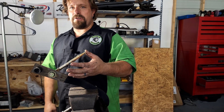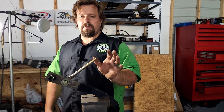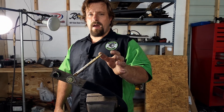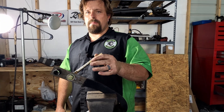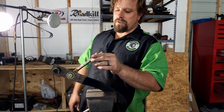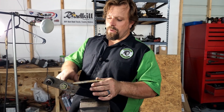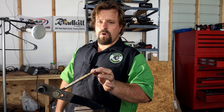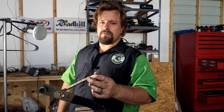We've increased our pedal ratio. That is also going to increase the throw on the pedal, so make sure you account for that if you're going to do this. If you have limited throw, I have almost 14 inches of throw on the pedal in that truck, so I should be just fine. The only other thing I have to figure out is a pedal stop so that this rod, which is no longer going to be hooked in the master cylinder, doesn't fall out and we lose the brakes altogether.